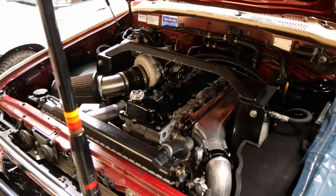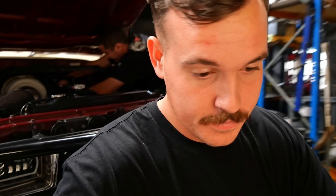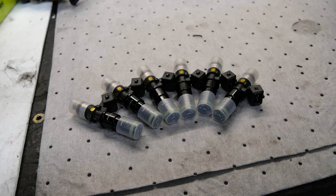Most of you watching would have seen the last episode. What we've most likely decided the issue is: the injectors in there were CNG — compressed natural gas — injectors. We think they're corroded and gummed up, and they're playing up, which is probably what caused our issue on Moreton Island. The solution is these liquid-fuel-specific injectors — all stainless steel internals, specifically designed for ethanol, 98, etc. So fingers crossed we put those in and have a 98 flex tune with no more misfiring.